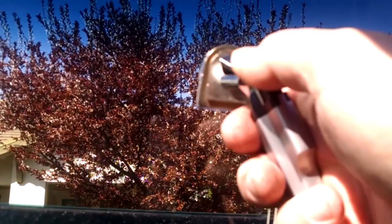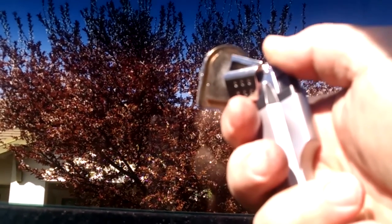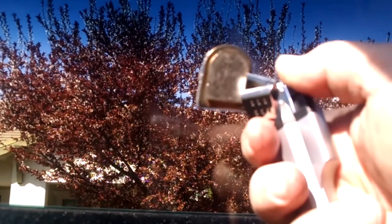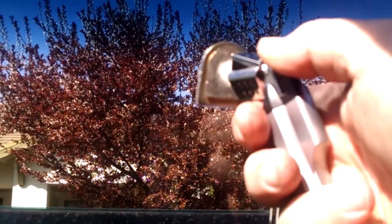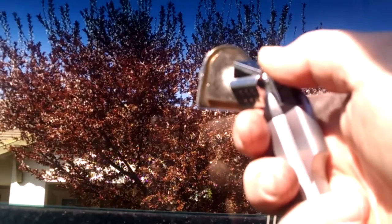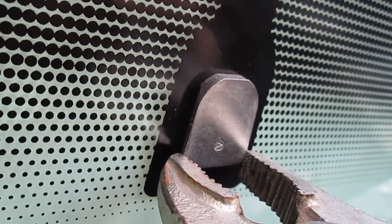Precautions: Here are some precautions when removing and replacing a rearview mirror from the mounting bracket or removing the mounting bracket from the windshield. It's best to apply heat to a mounting bracket with adhesive when the temperature is around 50–70 degrees Fahrenheit. Do not apply excess heat on the adhesive to avoid breaking the glass. Be careful when ripping the mounting hardware off the windshield to avoid destroying part of the glass — you may use a razor or pen knife for this purpose.